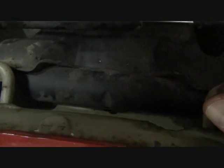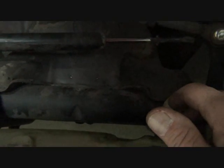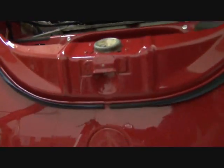this is your twin torsion beam on the front suspension here. There's a cover plate. This is the front of the tunnel. There's a cover plate there that must be removed. And then that shift rod is removed, comes straight on out of the car. Let's take a look under here and see if we can see that cover plate. You see it? You can see the 2 bolts that hold it in place.